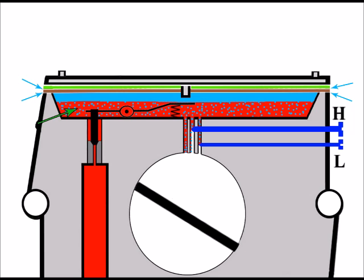So all that's left is this fuel here that's mixed with air with no backup whatsoever. So all that can be supplied to the engine through the jets is this erroneous mix of air and fuel. And that, of course, isn't sufficient to run an engine, so we'll have bog down.